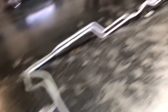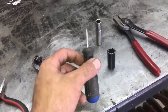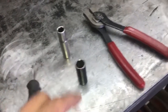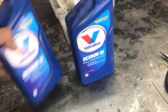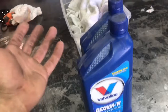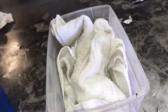So let's go ahead and go over the parts and tools we're going to need to get the job done. We're going to need some needle nose pliers, a 3/8 ratchet, a pick — preferably a 90-degree pick — a 10 millimeter socket, a 13 millimeter socket, and if you are going to be deleting your thermostat, you're going to need some snap ring pliers. Also, we're going to have some fluid leaking out as we remove the line assembly, so pick up about two quarts of Dexron transmission fluid and a bucket to catch any runoff and some rags to clean up the mess.